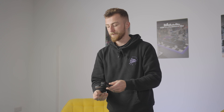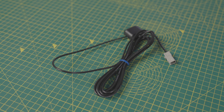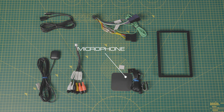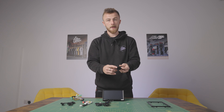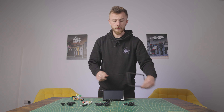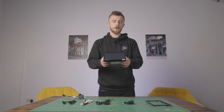This is your GPS antenna. Because it's wireless CarPlay, this must be connected to allow the wireless CarPlay to work, and you also get a magnet plate as well if you're sticking it to the top of the unit. This is your Bluetooth microphone — nothing fancy, just a standard Sony Bluetooth mic. They also give you a flat mounted adapter with a headliner clip, and a flat mounted adapter with a sticky pad. You have the facial trim, your main power loom, and then you have the unit itself.